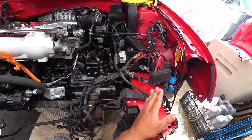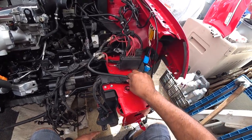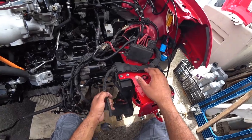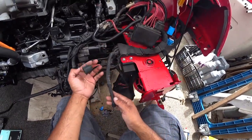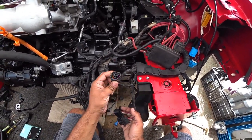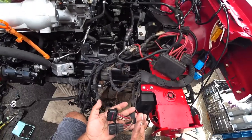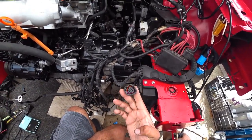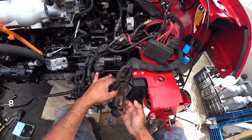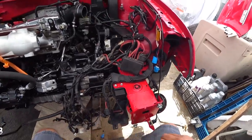We're going to split this into three looms — there are technically three looms in here. The first one is the most obvious, attached to your body rail or frame. This is your fan and fan control loom. You'll see your fan control module right down below. This is your headlight, which can be set aside. This is the fan control switch, and these are the actual fan wires that give the fans power, while this tells when the fans kick on and off. These you have nothing to do with until you put your front end back on.